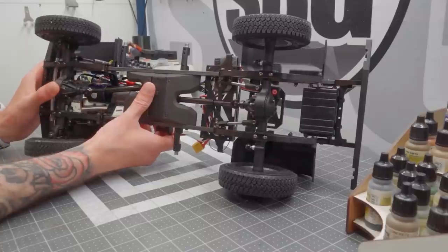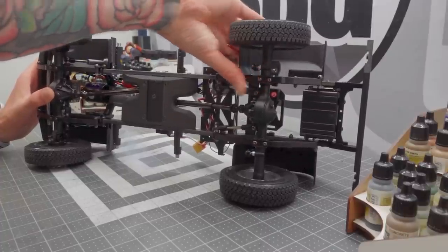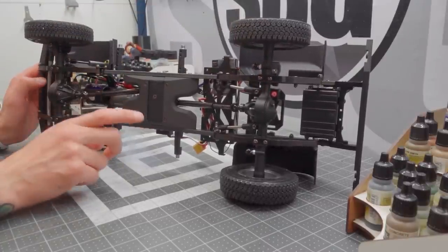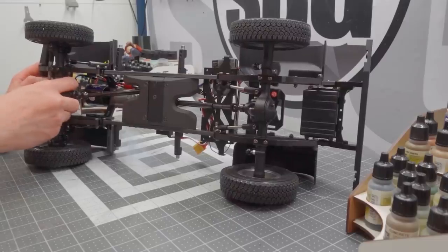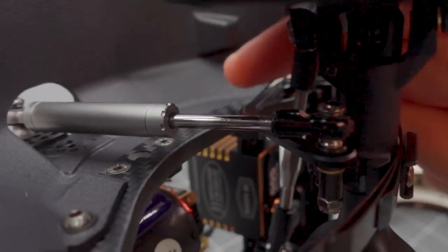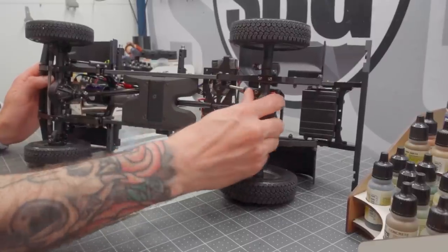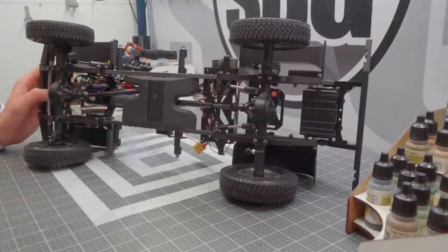There is a tremendously good amount of flexibility in these leaf springs. The design of this chassis compensates for a lot of the shortcomings of a typical leaf sprung chassis — you don't normally get a lot of flex, especially when scaling something down like this. That said, there's a pretty good amount of flex in this chassis; they built these leaves in such a way that they cycle really really well. One of the really cool things is that it includes anti-wrap bars both front and rear. Anti-wrap prevents the axle housing from torquing around under load, bending all the leaves and ruining them. Boom Racing included anti-wrap bars so the axles cannot torque against the leaves — it's a phenomenal system that is an aftermarket add-on for any other leaf sprung chassis.